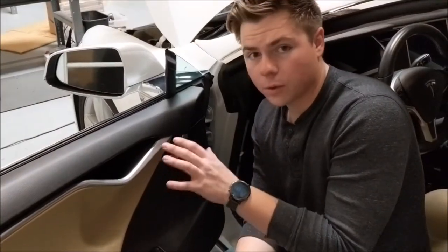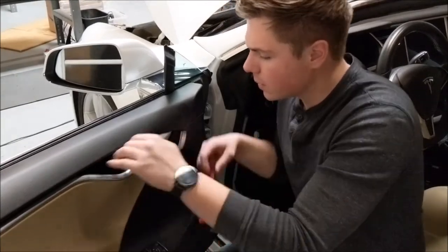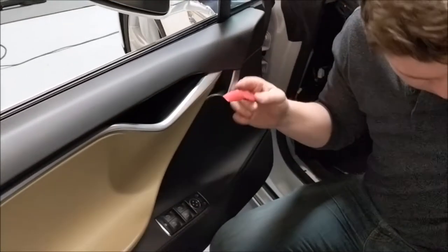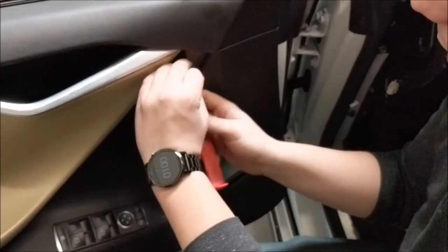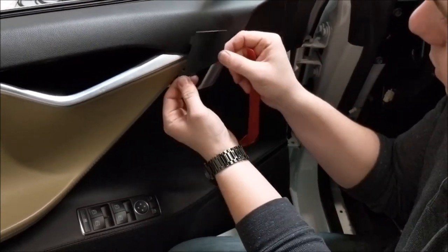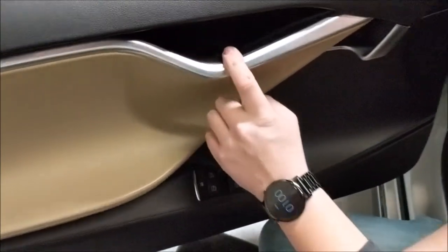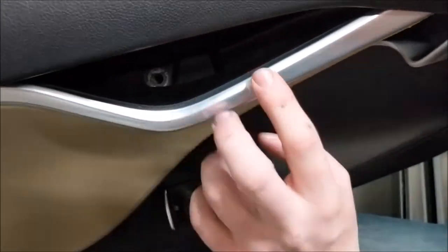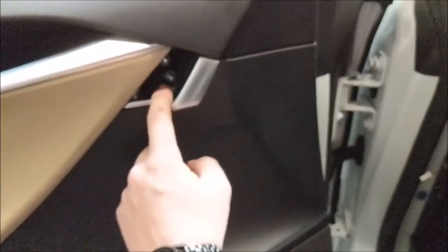To start the door panel removal, you're going to remove two grommets — this rubber one in here and this plastic one in here. Grab the handle and pull out underneath carefully. This only comes out at one angle, so make sure you rotate it and pull out this way. That's going to reveal a 9mm bolt on the earlier ones, and a 10mm bolt on all later ones, plus two T30 bits to pull out.